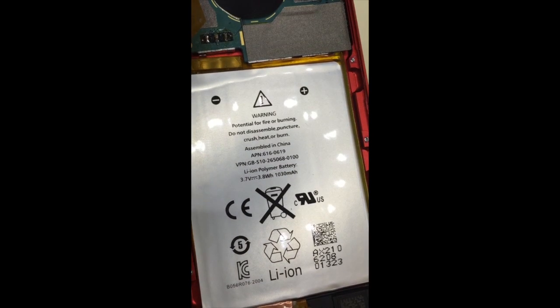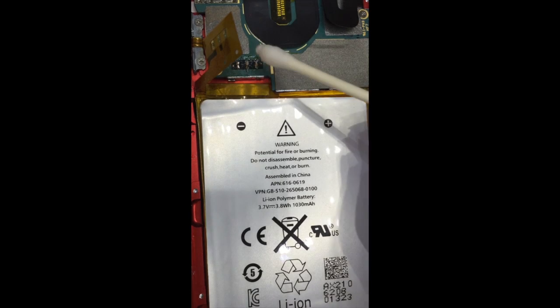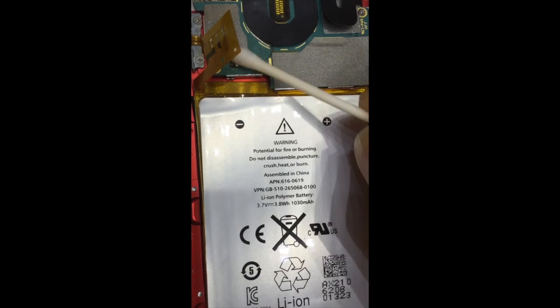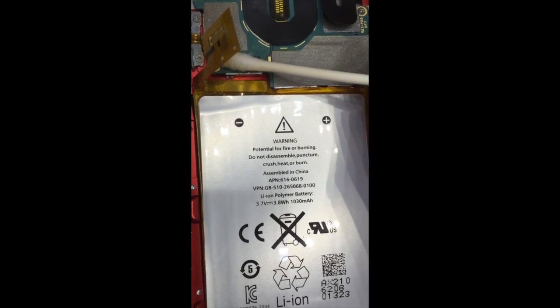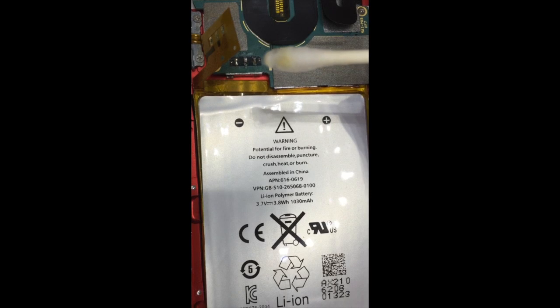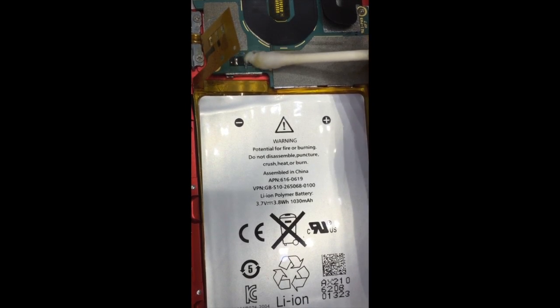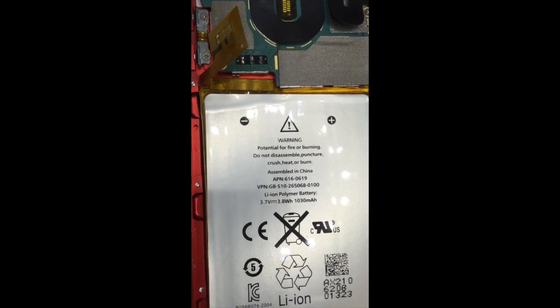And I'm just going to put it on my finger and roll it in, make it a small amount of cotton, and then of course I'll dip it in alcohol. Whoops, just spilled a little bit of it. Okay, and I'm going to clean up that joint right here. Don't leave too much alcohol in it, but like I said, it evaporates very quickly. That's much cleaner. You can see the yellow mark on the Q-tip. That's from the flux. That comes from the core of the solder. Just going to clean it up nice and clean, and I can proceed.